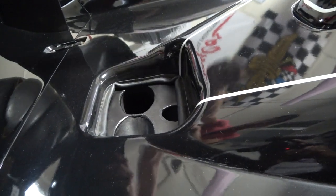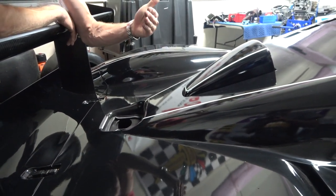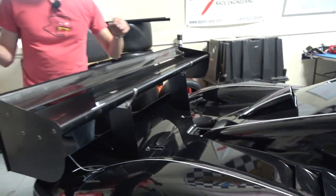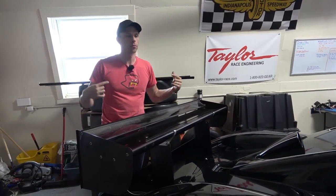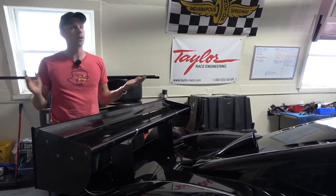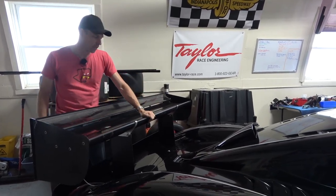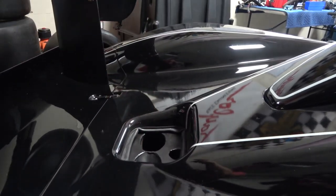There's a scoop right here and you can see the K&N air filter — that's actually for the engine's intake, which makes you wonder if it's raining whether there's any kind of water trap for that. There's also a hole here and a hole here that direct to the rear brakes. This area, being not on a leading edge of the car, must be a high-pressure zone, so air is going to want to flow into these holes — they direct to the uprights and to the center area of the moving brake rotor. A brake rotor is round with fins on the inside, and as it spins it works just like a water pump, drawing air through the middle and out the outside. Having higher pressure here where cool ambient air flows to the brakes — that's how that works.